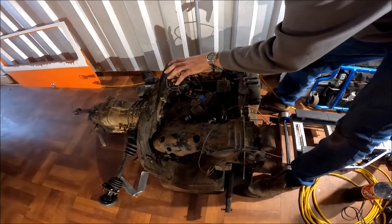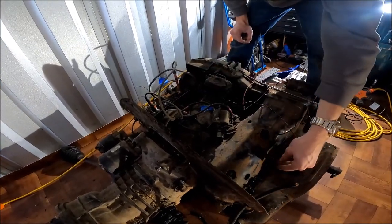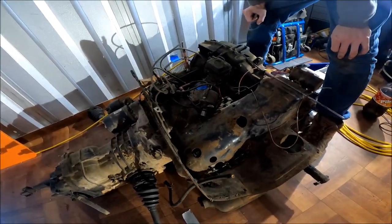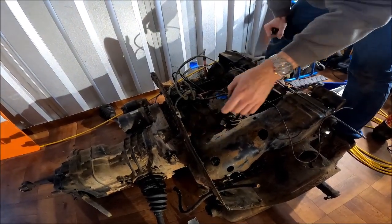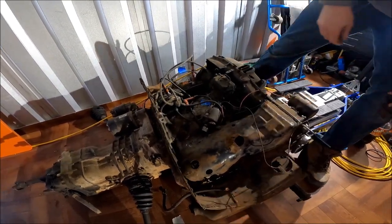After that, we started working on the carburetor, which ours is a center mount, and it has 2 runner tubes that come over right to it in the middle. They're secured in by these bolts here, and the runners are secured by rubber Ferncos with hose clamps on them. So we undid those, pulled the runners off, took the carb out. Now we've got top clearance.